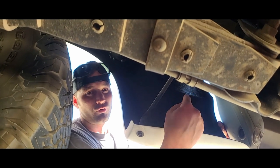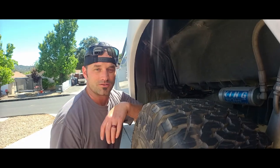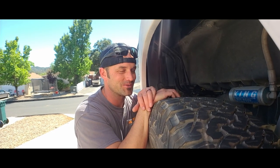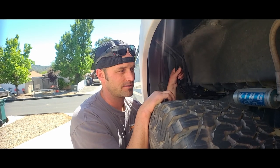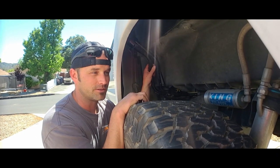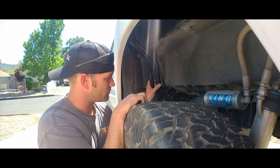If you have questions on the numbers I used for mounting locations, feel free to comment or reach out on Instagram and I'll share my measurements — though they may differ because the fiberglass isn't always precise, and if you leave it in a hot garage it'll form shape off the truck, which isn't good. These stock brackets are totally fine for now. Moving to the front of the fiberglass — there's way too much wobble. What's knocking is the bottom of the fiberglass hitting the cab, and there's only one mounting point up here which is a little flimsier.